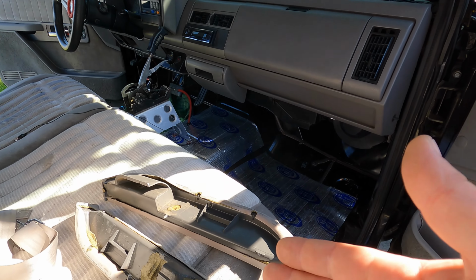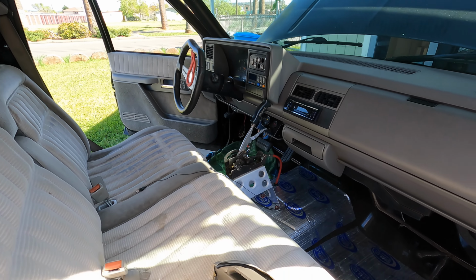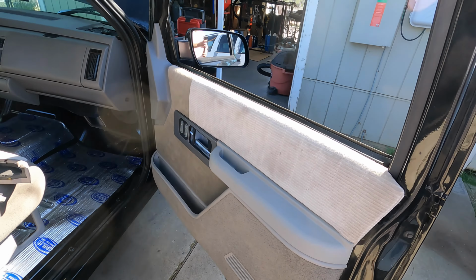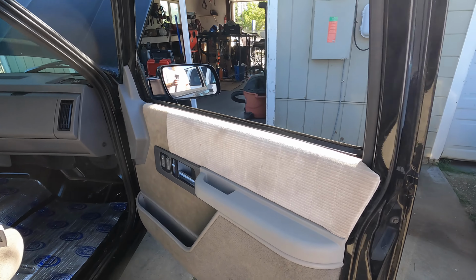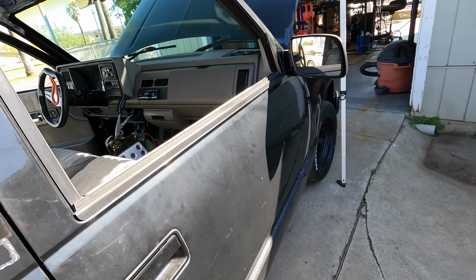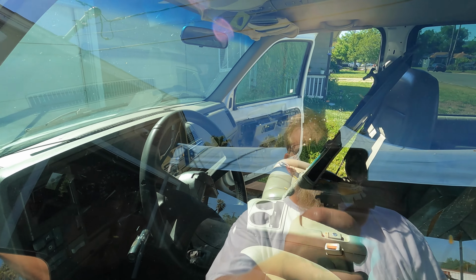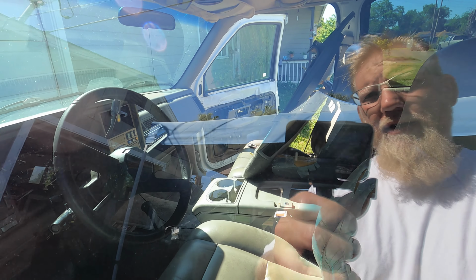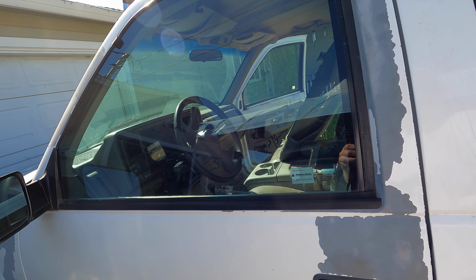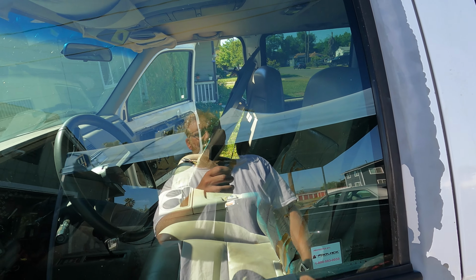Go from the old and busted to the new and fresh on both sides. Go out and get yourself some, guys. Fix your busted rides. Be careful of this 30-year-old particle board. And if you've got problems shutting your doors, you've got to fix that first. Because grabbing that handle to slam this door shut is exactly what ruined this door on the Suburban over there. Just slamming so many times because it was wrecked and just was way too hard to close. And that's why I had to do fixing the B-pillar, which I still haven't finished welding on yet.